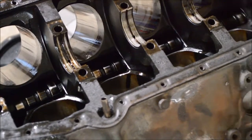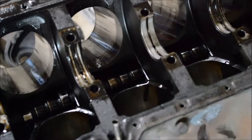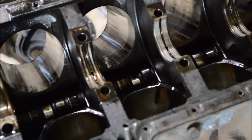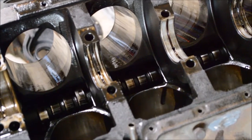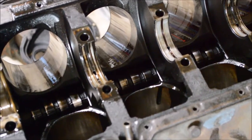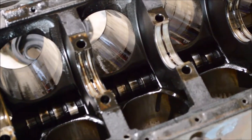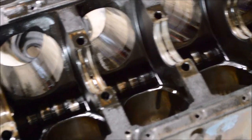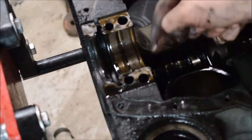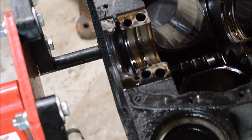Down inside here you can see the actual camshaft. You'll see those lobes on the camshaft that actuate the lifters. That camshaft gets oiled by the connecting rods, which have little flat areas that sling oil up onto the camshaft. You can see the rear bearing here, and there's also what's called the rear main seal which keeps the oil from leaking out.